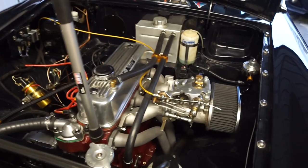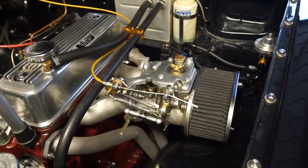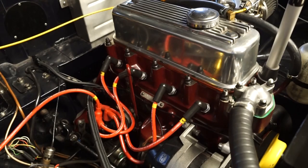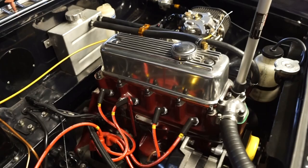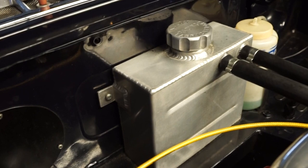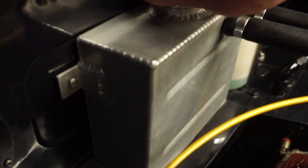Moving on to the engine, which is probably one of the most expensive and most important parts of the race car. You'll be able to see the Weber 48 carburettor feeding the cylinder head - it's still a cast iron head and a cast iron block, as we're not allowed aluminium cylinder heads. In the block we've got 1.2mm overbore pistons from JE, giving us a capacity of about 1843cc. We've got an all-steel crank made by Arrow Precision with steel end caps, just to make it as strong as possible. At the back of the engine there's a neat catch can - with a 2-litre engine you need a 2-litre catch can, which takes the breather from the engine into the top.